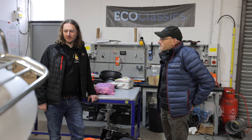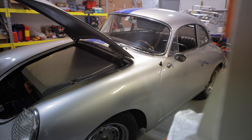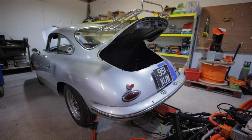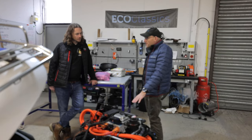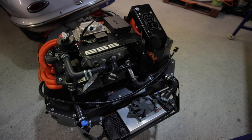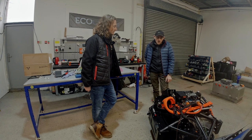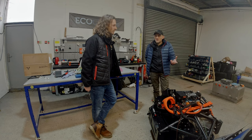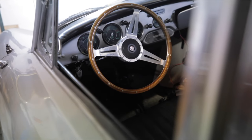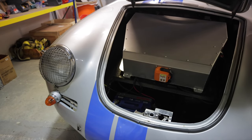You've got this wonderful car in front of us here. Yes, 356 — sort of 50s early Porsche. So we're working with a partner on this, Hayley Abbott. One 150 kilowatt motor in this one. It's got a relatively small battery — about nine modules, so it's about 20, 21 kilowatt hour. Just because there's not a huge amount of space in the car. We did try and put a larger battery in and it showed out the back of the car; it didn't look right, so we've made it quite a bit smaller.